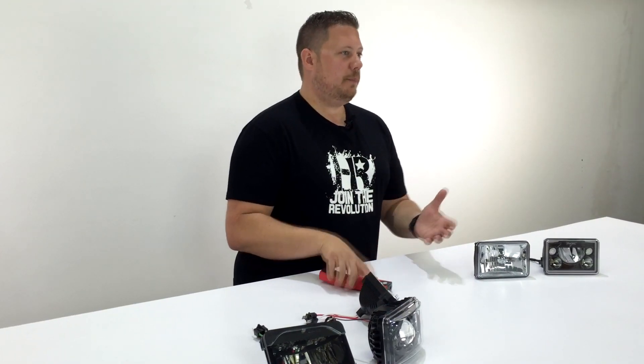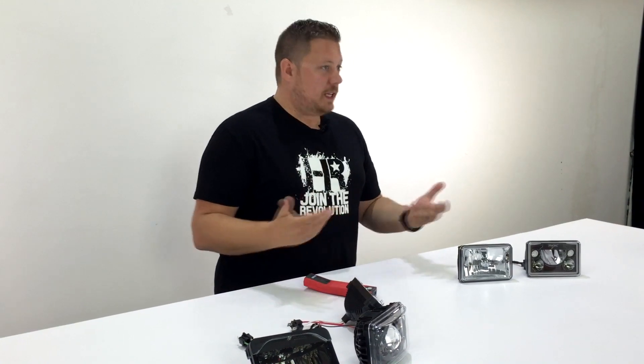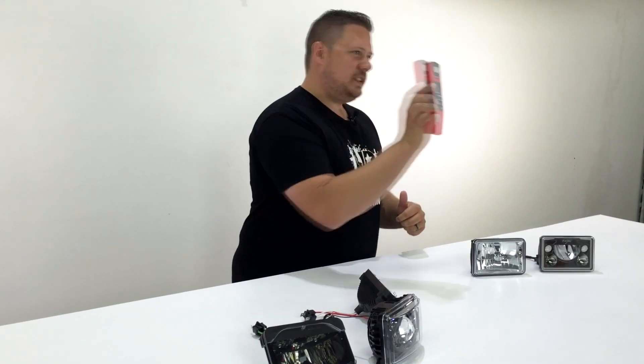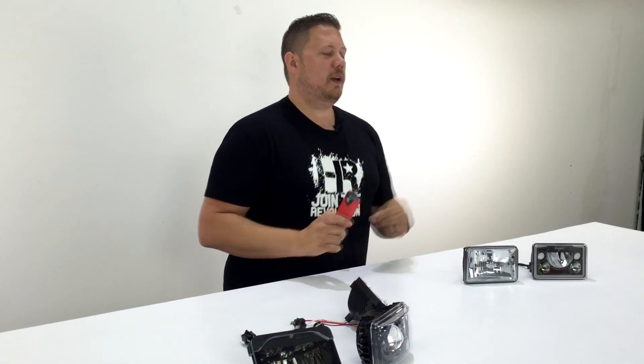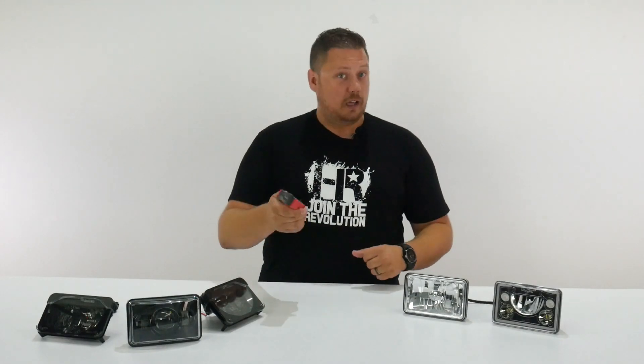What's the difference between lumen and lux, and why do you never hear about lux? To get the whole picture, you need to compare three things: the shape of the beam pattern, the lumen output of the LED, and how those two work together to create usable light in front of your vehicle — that's why we measure lux. Keep in mind this is semi-scientific; we're measuring every single point of the beam pattern and reporting the one brightest point as our benchmark for every headlight. To get the full picture, watch all of our videos comparing beam pattern, lumen, and lux.